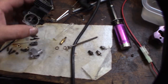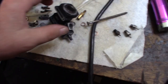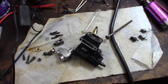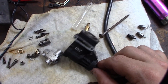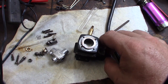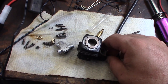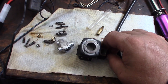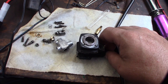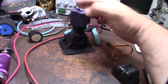I noticed that this thing has an insane amount of pinch. You can kind of see a little bit of the scuffing, but I don't know if this was re-pinched or if this has just insanely high compression — I can barely get it past top dead center. I might have to heat the engine up with my heat gun to see if I can get it to go. Somebody either properly or improperly pinched it, or this is some super high compression racing engine. There it is — put back together, the OS Max 12 CV.